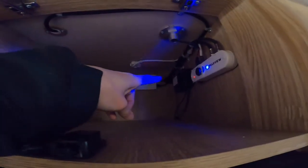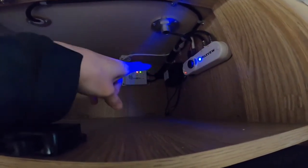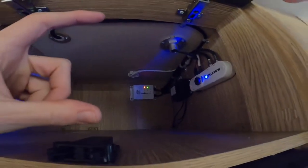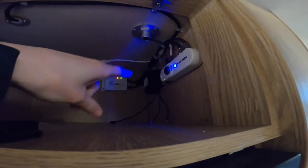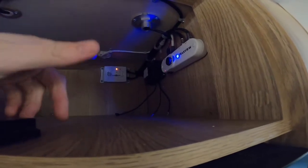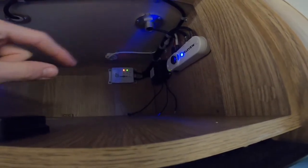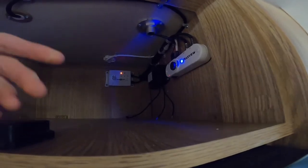At the back top corner, you've got your motorhome Wi-Fi. There is a router that clips on there — we've got it in the sales office — which requires a SIM card. It's a Huawei mobile Wi-Fi that clips on there and connects to aerials on the roof, which boosts your signal. You put your SIM in the back — I would advise going to your phone provider and getting a pay monthly SIM instead of pay as you go, as you'll always have data on it. If you take the back off, you'll also find the key for your Wi-Fi password. The SIM goes behind the battery.